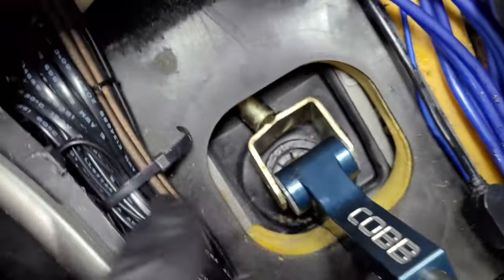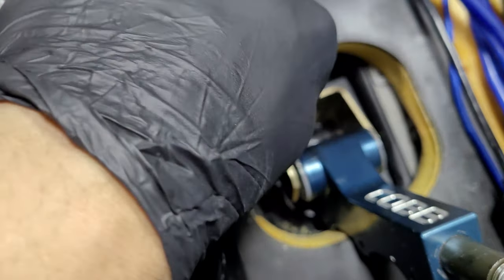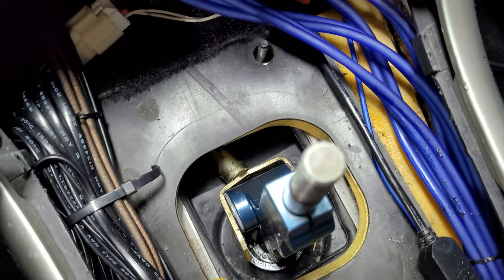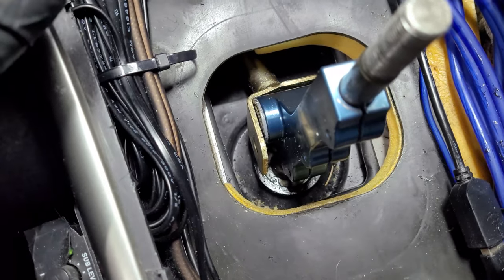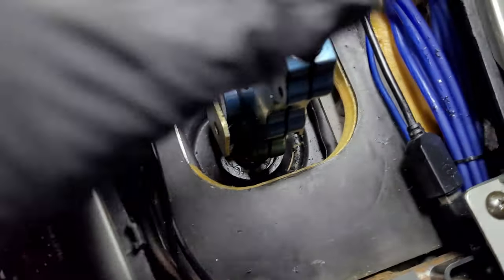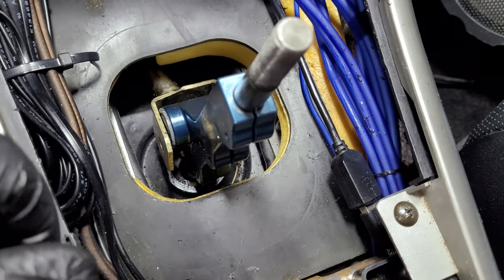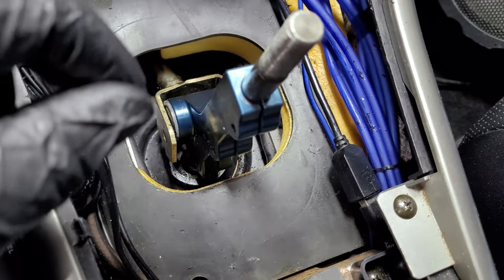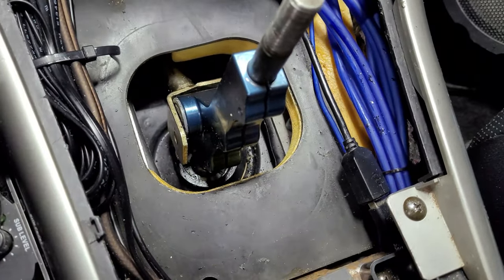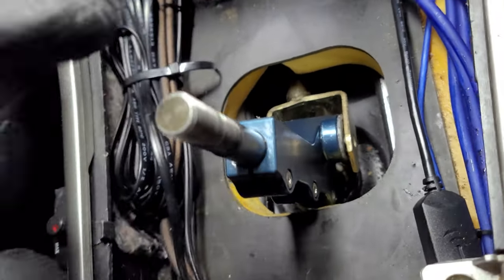So I fiddled with it for a while. I was finally able to get that snap ring in there, and I have the heads on the back side here instead of the front like it was before — really shouldn't matter though. Tips on how to do that: play with the shifter fork position. Just hit the clutch and take your hand and move it around so you can get the space you need, then use your snap ring and another pliers to force that thing down there. Once it's in, make sure you really stuff that shifter back down and take your trusty flathead and push it down, because what can happen is as you're fiddling around this can get a little unseated and sit higher, and then you'll think the snap ring is in there but it'll just pop back out. So once you think it's in position, push this down again, push the ring back down again, and you should be good. Now we're going to put the bolt back together and get the linkage all set up, and then we'll undo these allen keys and play with the height.